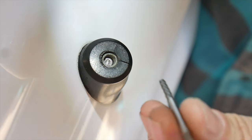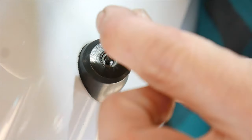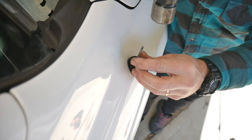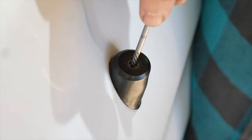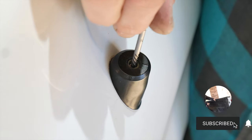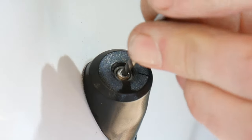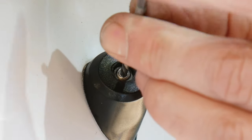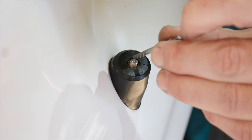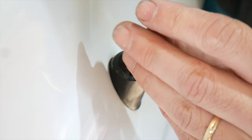I've been drilling quite a bit now, so I'm going to get the extractor bit, stick it in here, hammer it in, and see if I can extract this guy out by twisting it counterclockwise. A couple little taps — I don't want to break anything. It's pretty loose right now, so I'll just go counterclockwise... look at that! There we go — there it is! If I had made the hole a little bit deeper the extractor would have gone further in, but it was loose enough you can just twist it right out.